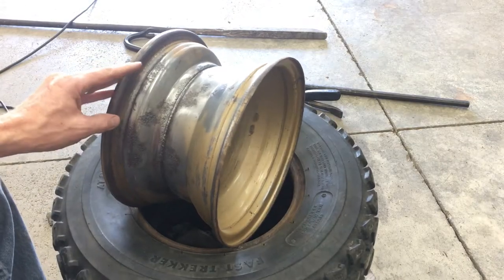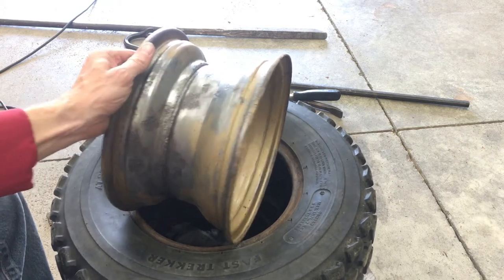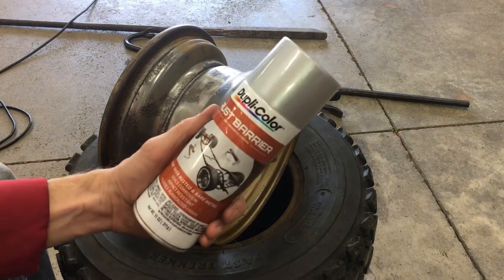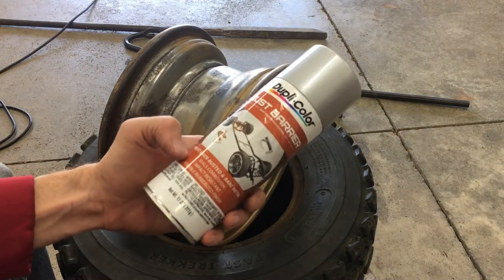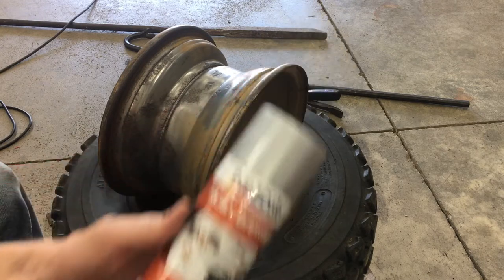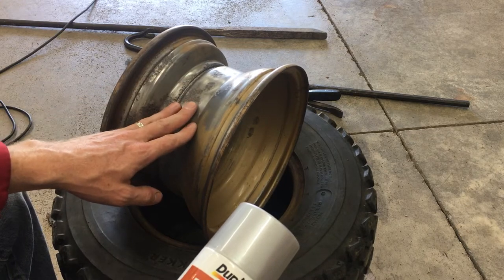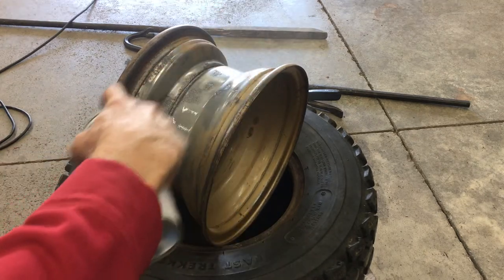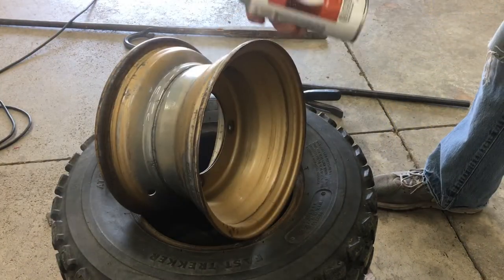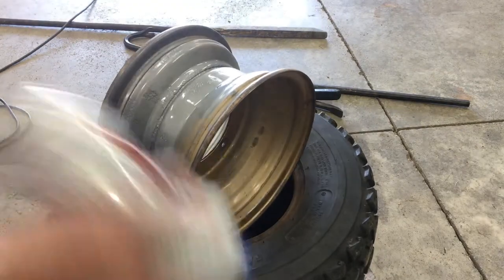This is really pitted here, and even though I hit it with the wire wheel and prep spray, it still needs some treatment. So I have some rust barrier here — it's formulated to go right over rust like this. That should seal it up and stop it from coming back. It's silver, but it's on the barrel and it won't be visible with the tire installed. A couple light coats are better than one runny heavy coat. First coat has had time to dry — time for coat 2.